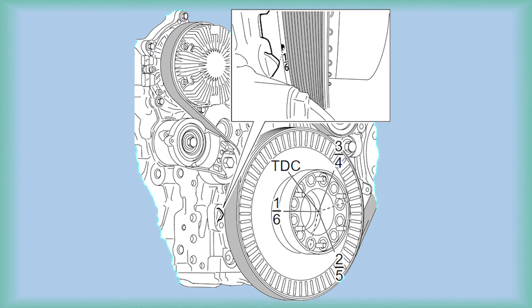There are three stop positions on the flywheel and front pulley related to adjusting the valves. These are 1-6, 2-5, and 3-4. You can position the crank in any of these positions to start the valve adjustment process.